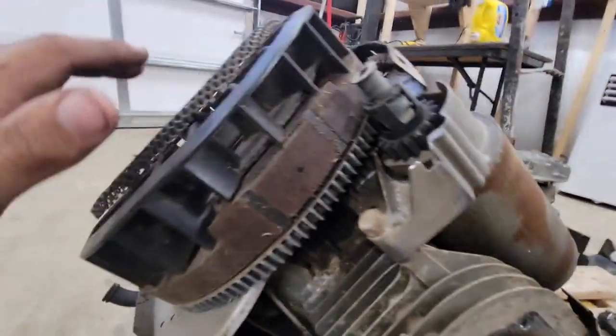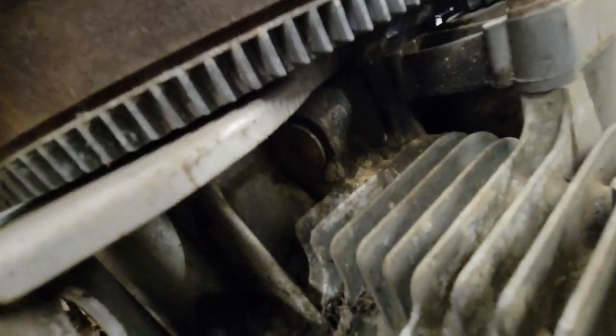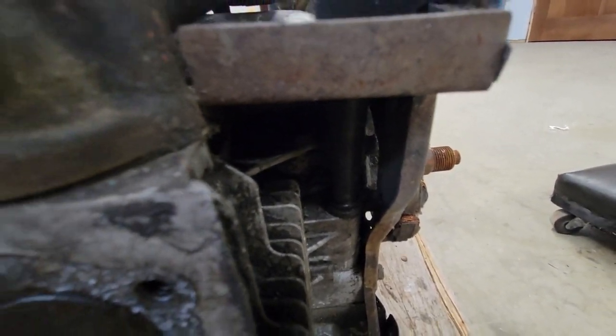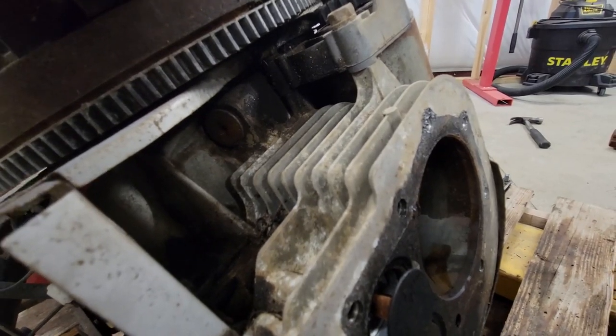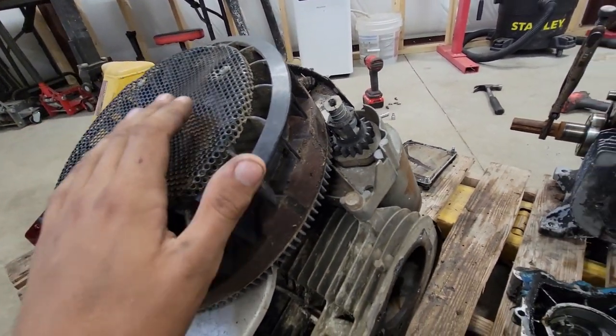The vertical block already has some of them with a plug put in there, like this one - you can see there's a plug right there. All I have to do is unscrew that and that oil dipstick right there will actually fit right in. There's a hole already in there for it. Some of them you actually have to drill that out and put some silicone in there to keep the dipstick from leaking.